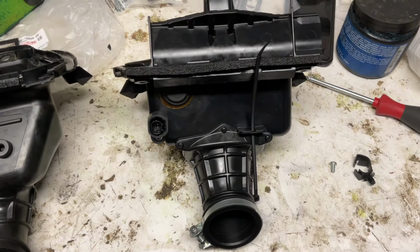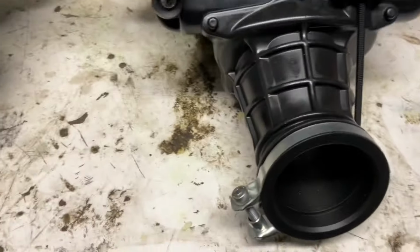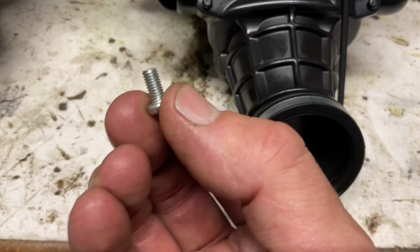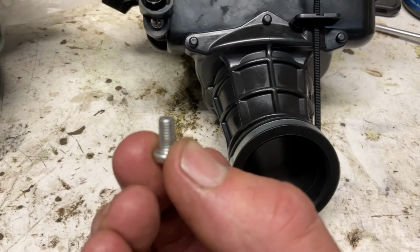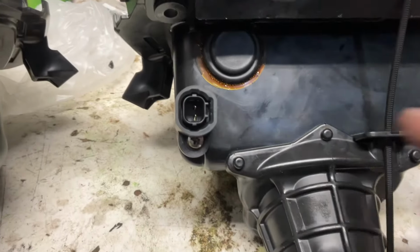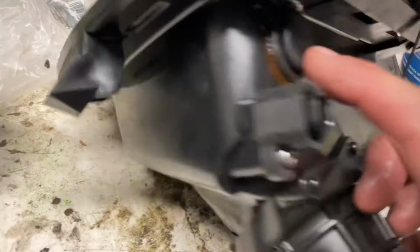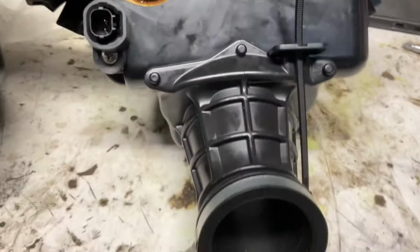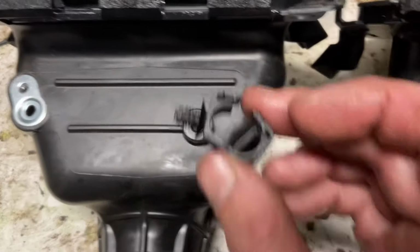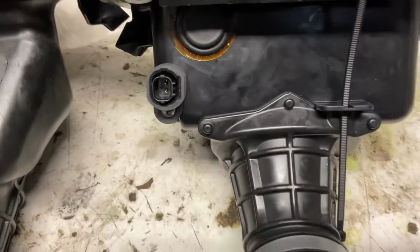Okay, got the airbox here. You're going to mount the sensor on it, and instead of the machine screw, you're going to use the screw that he provides, the more aggressive screw on that sensor. You've got the plug. You're going to have to get in there, make sure it's nice and snug in there. It's not going to leak. Instead of the cable tie that was here, I just got a zip tie that I'm going to use right here. There's no port for that.